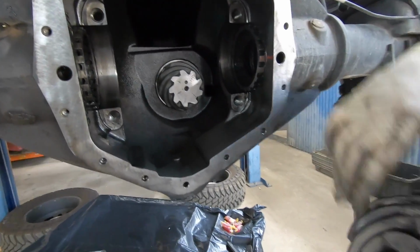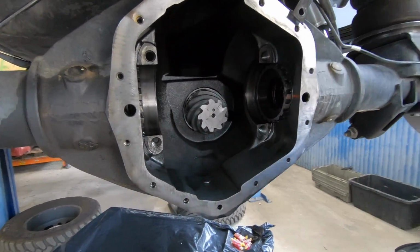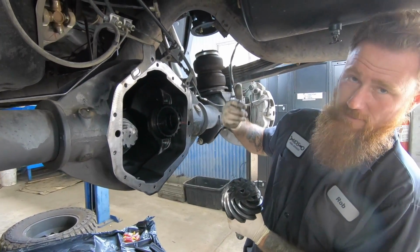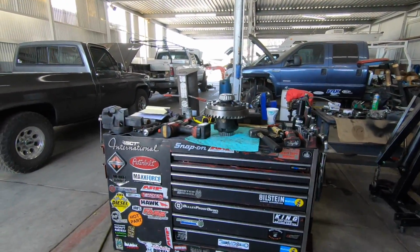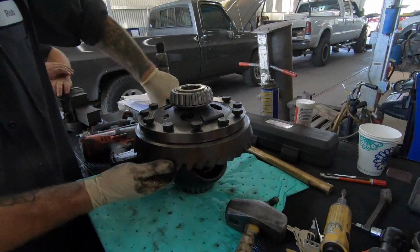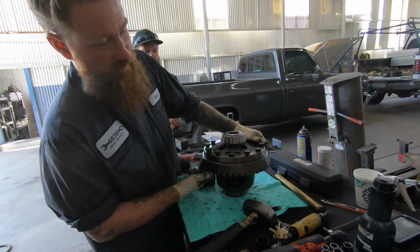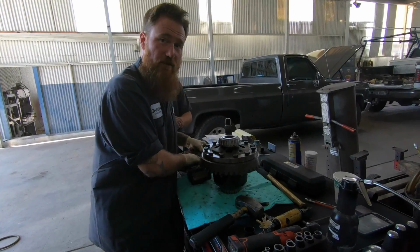And so what happens is the drive line is going to turn more revolutions per tire revolution. Okay, so thus increasing the torque output. Very nice. How about the bigger one, the big boy, the ring gear? Just with the naked eye, they get a little fatter or a little skinnier, and it's all on the tooth count. But just at a glance, you're not going to notice much of a difference.